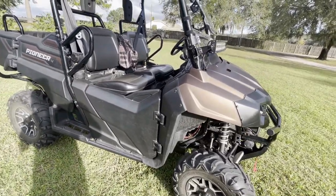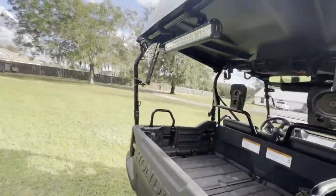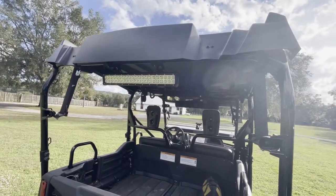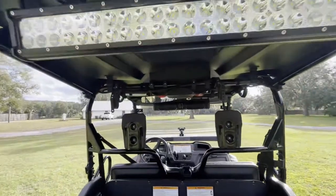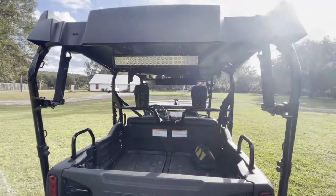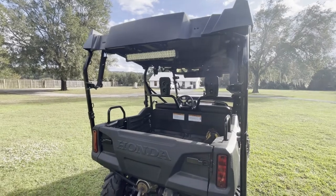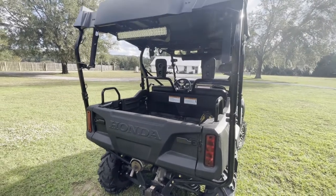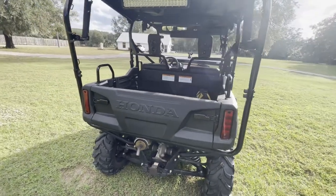Next thing, sticking with that light bar theme, is the backup light. We went with the 20-inch Nylight, mounted right there. We feel that's the perfect size, especially with the shape of the roof on the 700-4 — it fits perfectly, and when you lean into the back of the buggy you don't hit your head on it. It's super bright and hooked into the Aux Beam switch. There are options to hook it into the buggy so it comes on when you put it in reverse, but as we discussed in the article, if you're riding in a group and need to turn around, you'd be blinding everybody behind you — so we like ours on the switch.